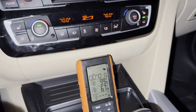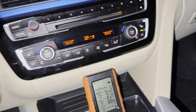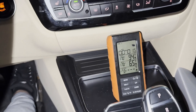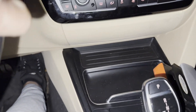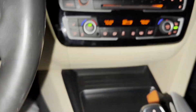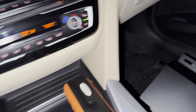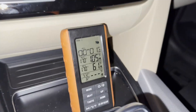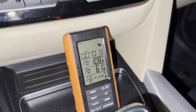Basically when you're driving around and the air is flowing over everything, the temperatures usually drop. But when you come to a stop, the temperatures start to rise. So right before the pull, we're at 91 and 64. And right after the pull, we peaked at 108 by the turbo and the temperature by the intake is lower at 61.